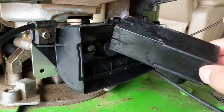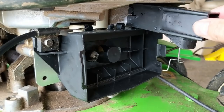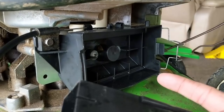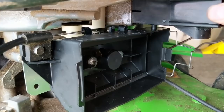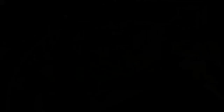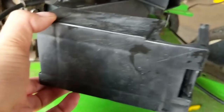Occasionally even I forget little things — there's this little air box vent that is supposed to poke into that little tube, but they don't make the slot go all the way down so the carburetor and air box have to be loose. I loosened it off, dipped the carburetor down a bit, popped the vent onto the post, and slid it into place — you don't have to fully remove it, just get the post down far enough. Then re-tighten the bolts. I've now installed the air filter because I don't want any gunk from the fuel tank getting inside the air box. Once it's snug, snap the cover on and the air filter is in.